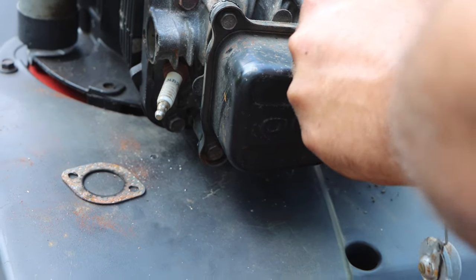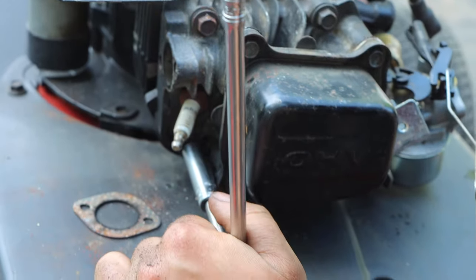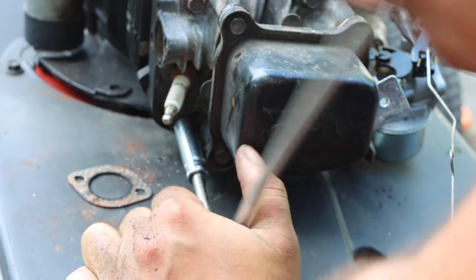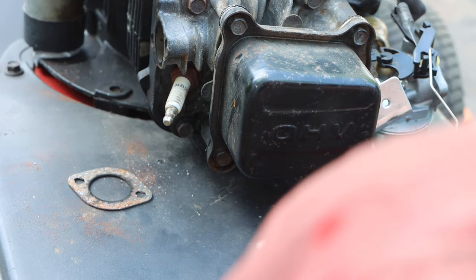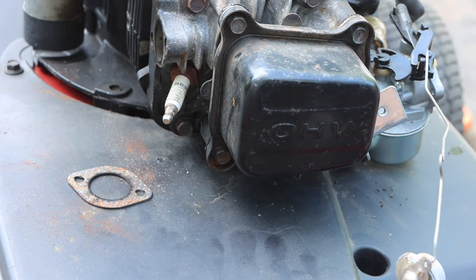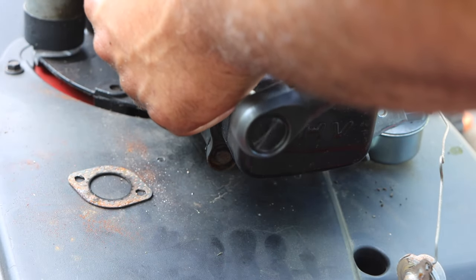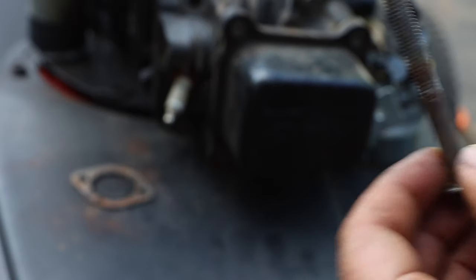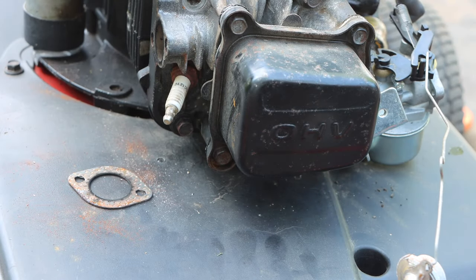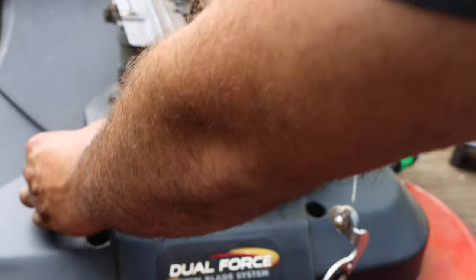See that? This one was a little hard to come out, which I guess is a good thing. That was very loose. I wonder if a loose head bolt was my issue. But it's too late now. We're here. Okay, I broke it loose. I'm gonna switch over to my ratchet. If you don't have one of these, that's fine. So apparently, these bolts are undersized, and if they weren't undersized, we wouldn't have this problem. From what I read, just sharing that, don't hold me to it.